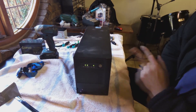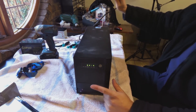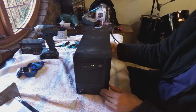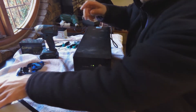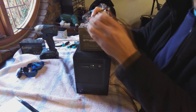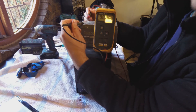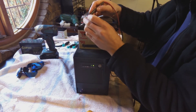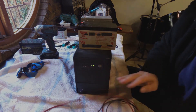Okay, let's turn it on. I can hear it going and it's unplugged, so it's now working off the battery. If I plug in the power — yes — and if I unplug it now it goes into UPS mode. The key point of this video was that when you measure your battery and it's literally at zero volts, that's a dead battery. That was the problem — the cells had gotten way too low: one at four volts, one at seven and a half. Thanks for watching.